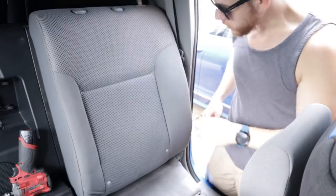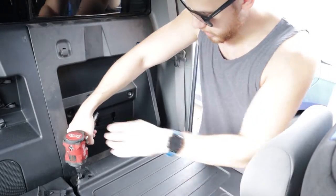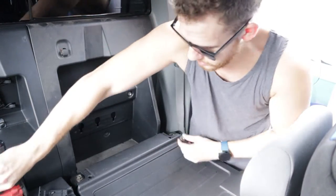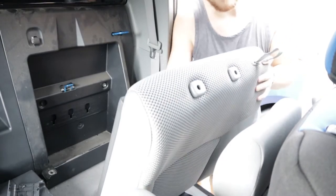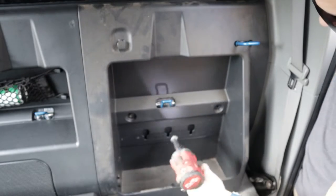Voiceover Javi here to run you through this quickly. You're gonna fold the seat down, pop these two covers off the back — these require a 14mm bolt on each side to pop your seat off. Take those out and then you can remove your seat, which gives you lots of access to remove the back panel. Next, remove the three 10mm bolts on the back plastic panel.